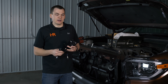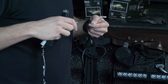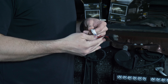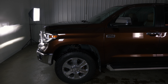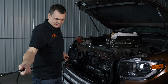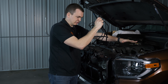They supply everything you need to run into the dash as well. Go ahead and unwrap your wire harness — you'll find this white plastic plug. If you're running the toggle switch you'll keep it as is; if you're going to use the adapter like I'm showing you, disconnect the switch and plug this in instead. Normally what I'll do when routing a wire harness is mock things up and lay them where I think I'm going to put them to gauge how much wire I have. Diode Dynamics was pretty generous with wire length, so I've set the relay and battery connections up here next to the battery.